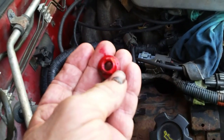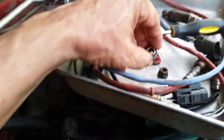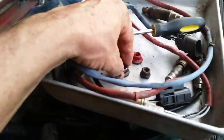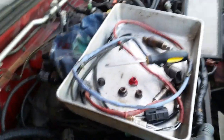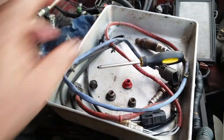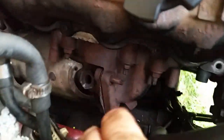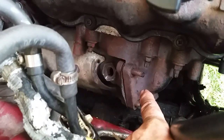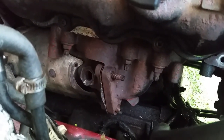Make sure when you're putting these back on that you don't mix your nuts up with other nuts. Although they'll go on, if you've got one that goes on kind of hard — stop. Because if you don't, you're going to end up actually breaking your stud. These studs, if you oil them up, they zip right off the bolts and the nuts on the studs there.